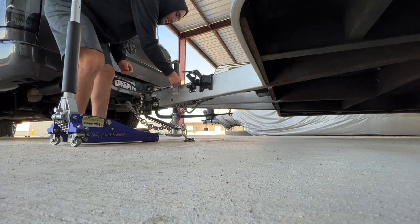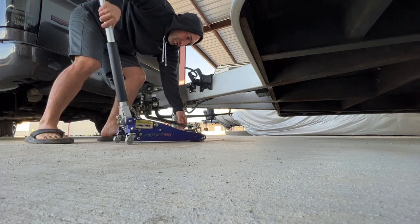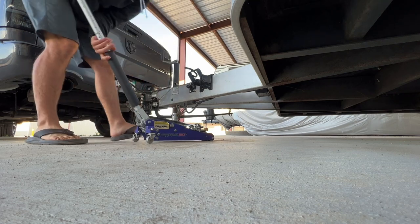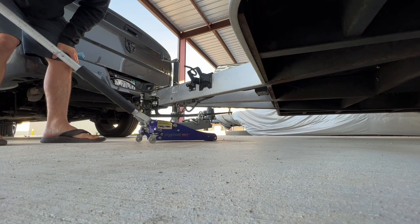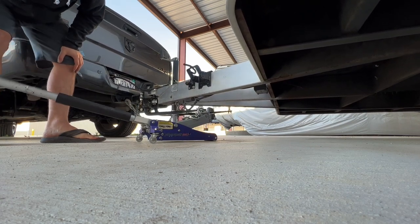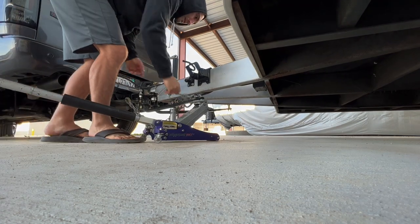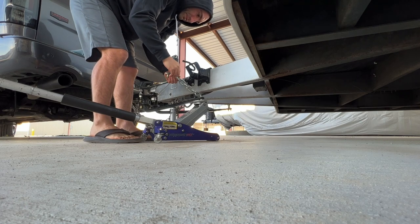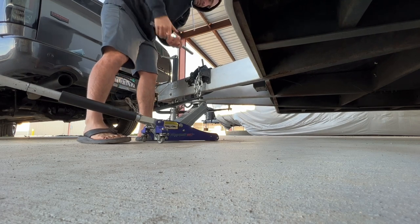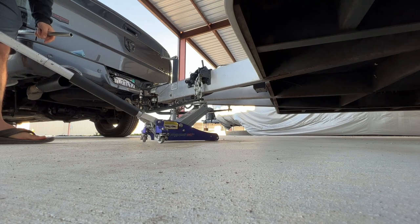This bar goes down and you also have an assist bar to help you, but by the time you lift it with the jack you don't really have to do a whole lot. I just do like this and you can see how it operates — see how the trailer goes down, and as soon as I start lifting up on this you can see the trailer start to lift up. I'm putting this on here, counting my links to make sure it's equal to the other side — one, two, three, four — hook it on. You can see how easy it is instead of fighting it like a maniac without the floor jack. Put your cotter pin back in and let off.